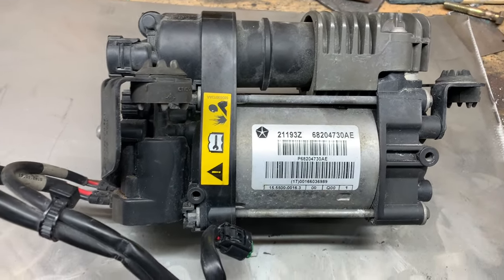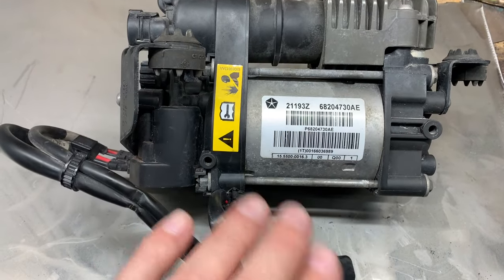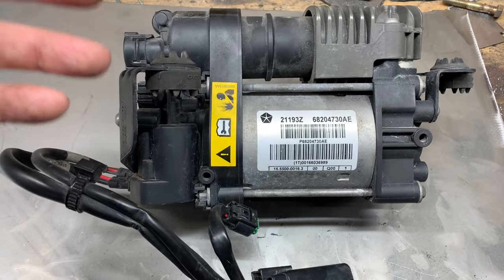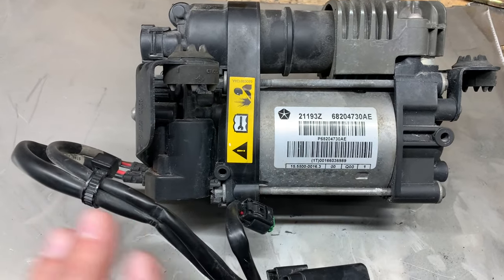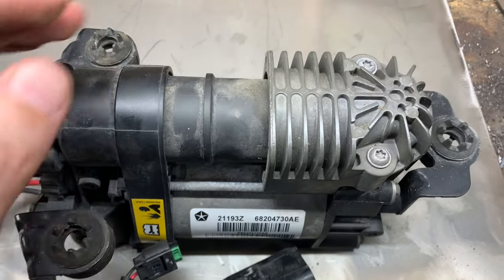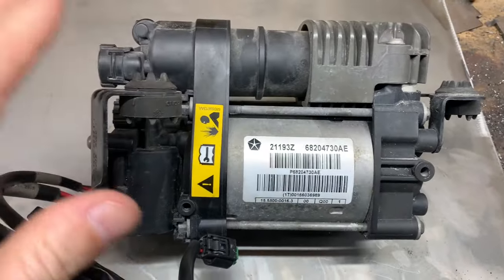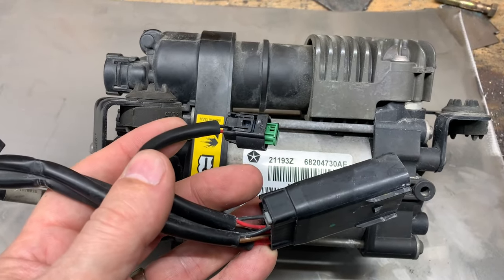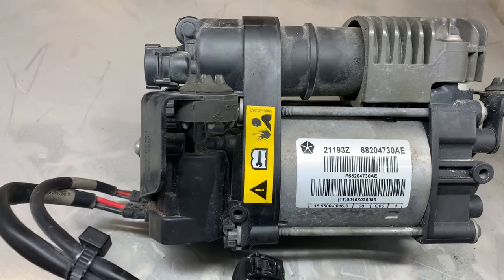One other thing to note: if the pump doesn't run and you can't hear it run, check your fuses and your relay. There are three fuses and one relay to check. When you open up your fuse box in your engine bay, read down the words and find the fuses. Maybe something like that's bad instead. Also, the thermostat wire could be damaged or broken if the vehicle has been in an accident with frontal damage. These are just some things to look out for. I haven't found much that people really talk about on this subject, and I'm not an expert - I'm just trying to give you the best I can. Generally speaking, this is the way it all works.